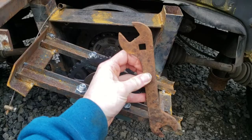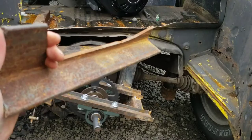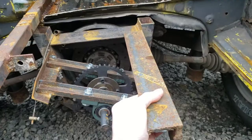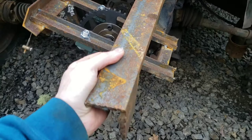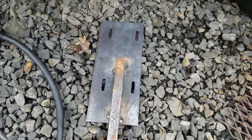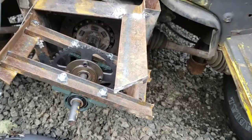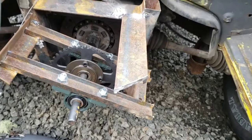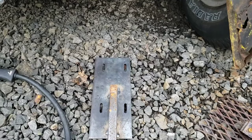I'll probably end up using the wrench somewhere out here as a support. What I did find though is something the same height, and I can come from here and weld onto there as well. I'm going to cut this pretty jagged and ugly so it's kind of a spike toward the back of the car. My first two orders of business were to tack the brace I decided on to the bottom of my motor plate, then tack this piece which I cut nice and sharp. Now I should be able to set these together and I've left enough room for my bolts to still adjust.